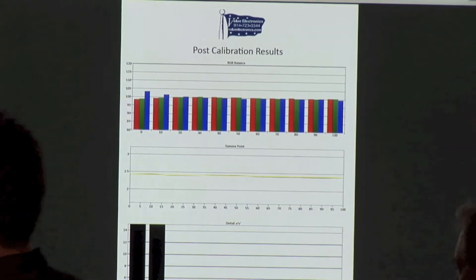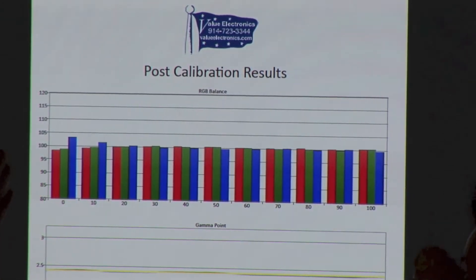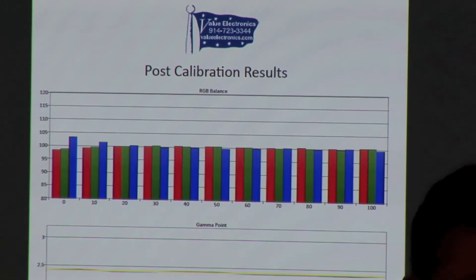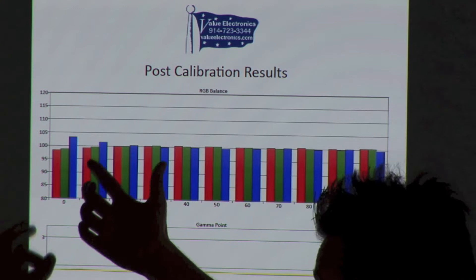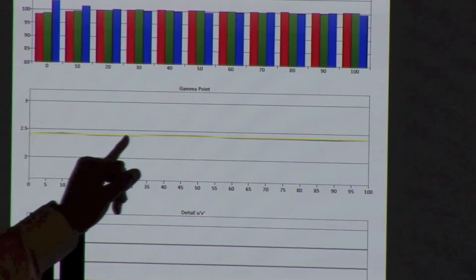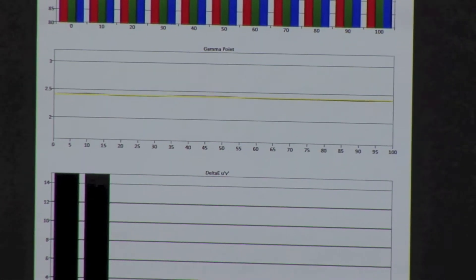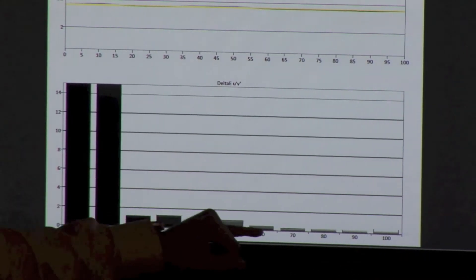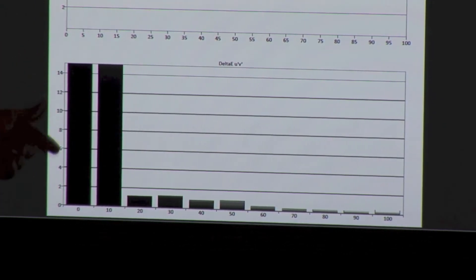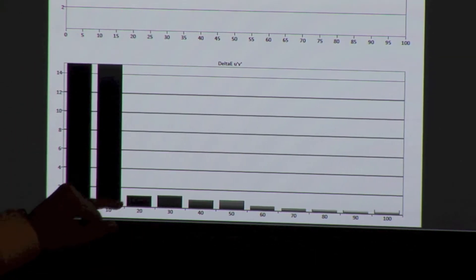As you can see, it's pretty flat except for 10%, but it's cool blue — but that's nothing. This was a long average read, so this might be what you guys could see in the dark scenes that had a purple tint to the blacks. Gamma is straight — this is acceptable gamma, it's right there. This is ISF night. You can clearly see by the excellent grayscale tracking, there was no issue with the 10-point white balance at all. Here are your errors — 10 and black are the only ones spiking up. But 10 is above 14 on this scale, whereas everything else is at one or below one.